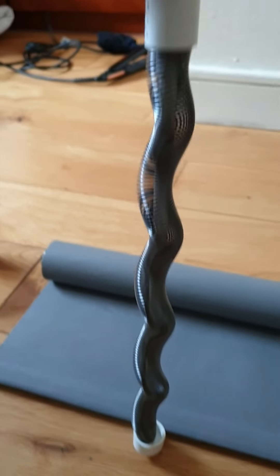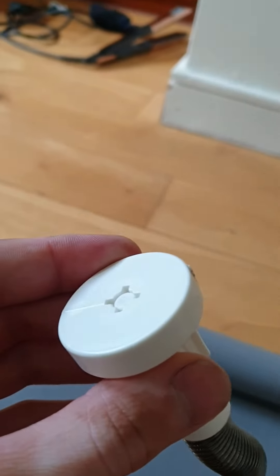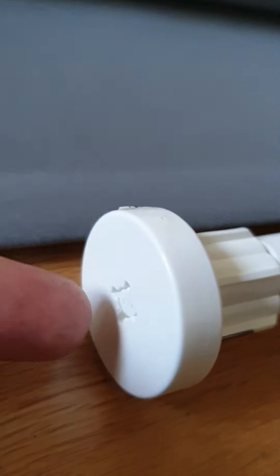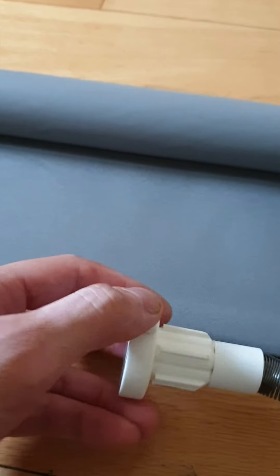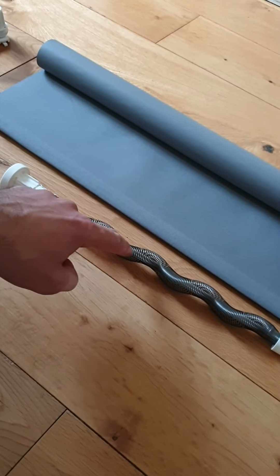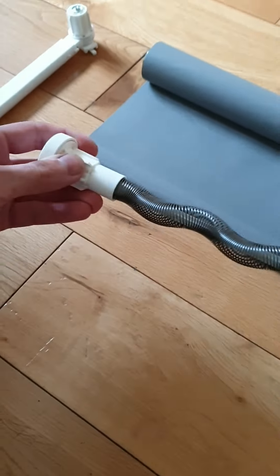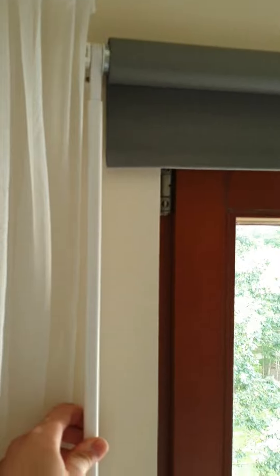Counterclockwise, the spring will lose its shape and go straight. Ideally with another person, hold one hand here while the other person presses the button, and with your second hand spin the whole thing counterclockwise until the spring gets about four and a half waves loaded around the barrel. Then put it on the right side and you're ready to go — and that's how it works on the left side. Works perfect.